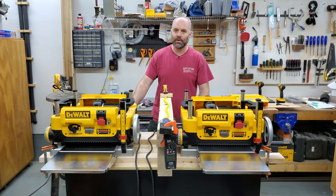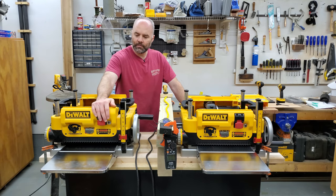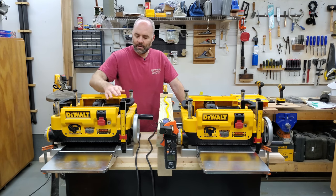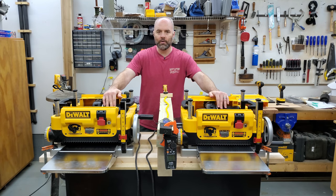But yeah, you can see this one got worn out, and all that happened really was this breaker in the front, this is just like the circuit breaker in the wall, and when it gets hot enough, it's going to pop out, and that will protect your motor. I opened both of these up just so I could feel around the motor, and actually this one felt quite a bit hotter, which I thought was kind of odd, because this is the one that tripped.